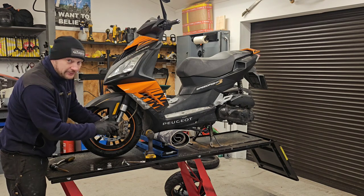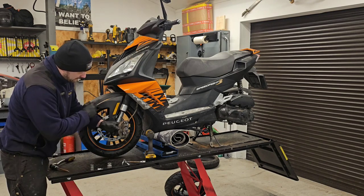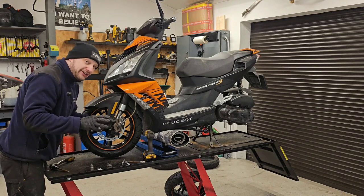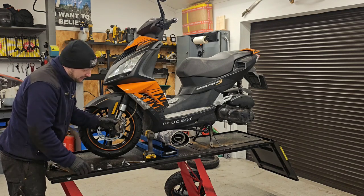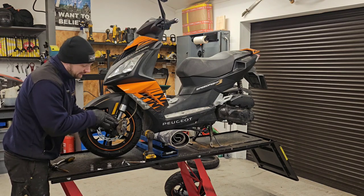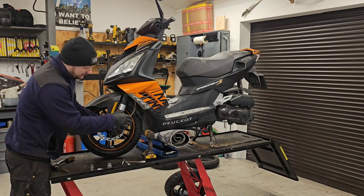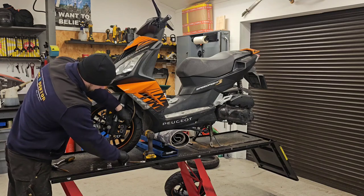If they're going sideways, it means one of the pistons might be stuck and only one is doing the job. That can be dangerous because your wheel might lock up one day. So just look at the brake pads, visually inspect them if they're okay. Not necessarily clean, because there's a lot of mess here, and it's supposed to be. The brake pads are wearing and they're creating all this dust. This can be addressed when you're washing your bike. You can wash it more often, but usually you do a proper maintenance of the brake caliper when you change the brake pads. So just check everything is nice, there are no leakages, and then you can just mount it back on your bike, just like that.